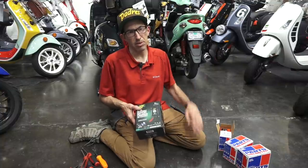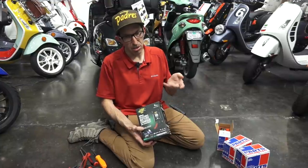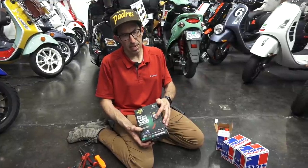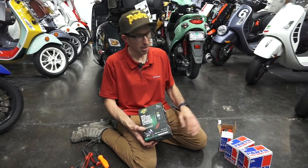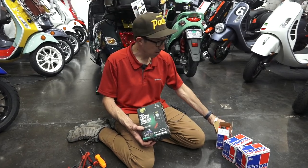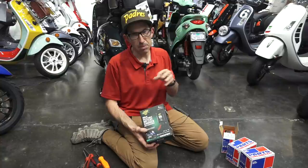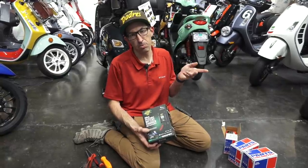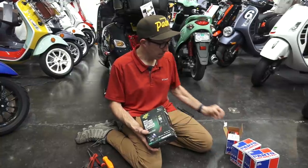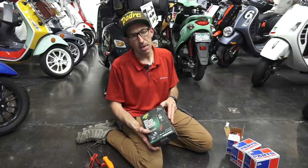It will bring it up to about 70%. If you have a Battery Tender, Optimate, or Noco charger set to lithium mode, it's going to bring the battery all the way up to a full state of charge, or just under it — because these batteries usually store best at a 70 to 90% state of charge. Charging to about 14.7 to 15 volts brings them to 100% but they don't quite last as long.